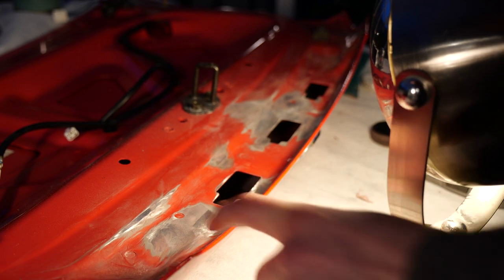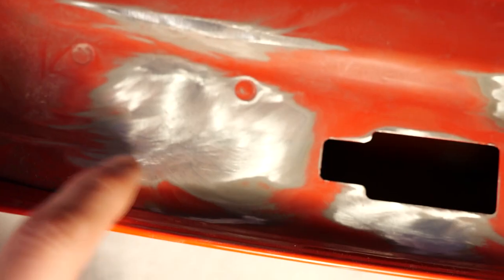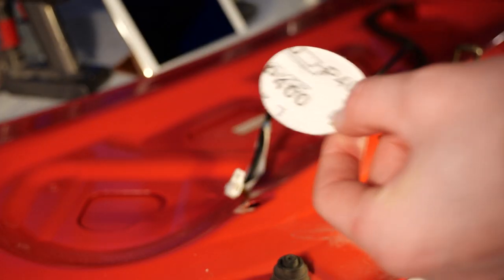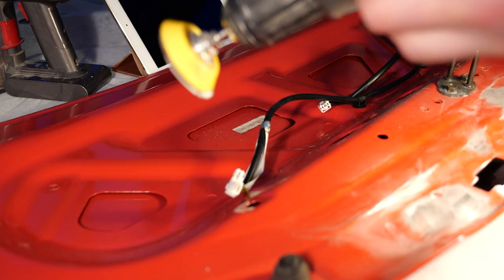Now the 240 is done, I'm going to put on a P400 and do the whole process again to get it really nice and smooth. You can see that all the pitting has completely gone, which is exactly what I wanted. Those have completely gone now. I'm also going to go for a slightly higher speed — this was the first grit and this is the second.